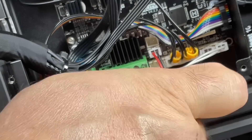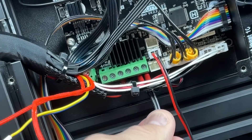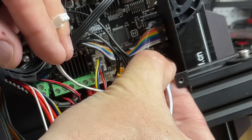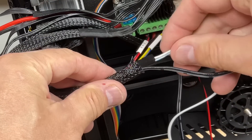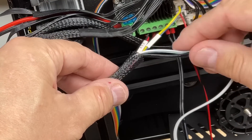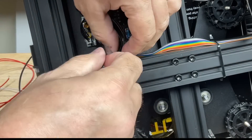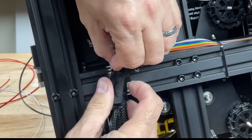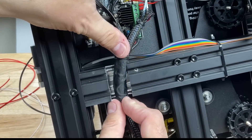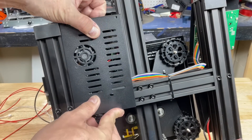There's no polarity here — no positive and negative — it doesn't matter which one you put in; they're equal. The next step is to install the connector for the thermistor. The new harness doesn't have a lock on it, which I don't like — it just pushes in place, so you may want to put some hot glue on that. Now I'm going to feed the other ends with the connector all the way through this loom. It's easier if you bunch it up and then pull it through. I was able to get it through pretty easily. I reinstalled all the tie straps and then the tape, which protects the wires from being cut by the cover. I checked for any pinched wires or resistance — there was none.